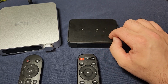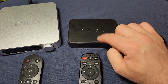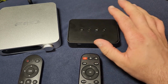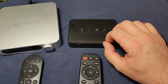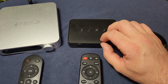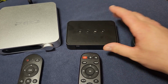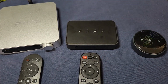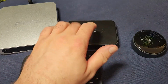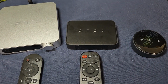So if bit perfect audio output is important to you, the digital output on this one is a no-go. And I did observe it struggle with handling particularly 192 kilohertz PCM files. It's like the conversion is not particularly clean. There were some skips and misses in higher res streams. So this one really is kind of limited to just Redbook 16-bit 44.1 kilohertz audio to be at its best. Okay, so those are the unique features on that one.